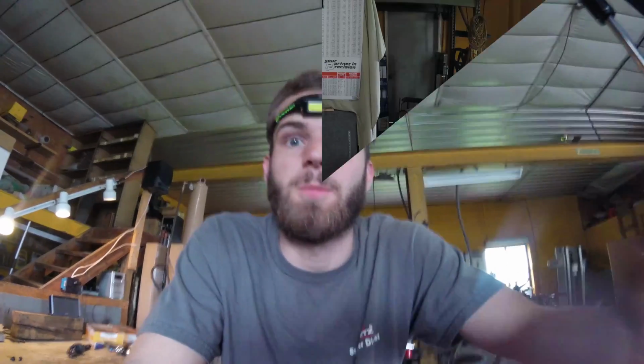I do a lot of exhaust wrap for work, so I'll have a pretty good idea of what I like and what I'm looking for and what will hold up. I will be wrapping it with stainless steel wire and twisting them on, which is better than the stainless zip ties. Don't use the stainless zip ties. They're terrible. They're hard to get tight. They don't stay tight enough, and they don't even look that nice. Use stainless steel wire. You can buy it most anywhere. Alright, here we go.